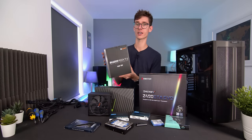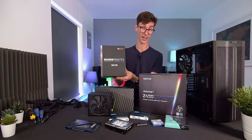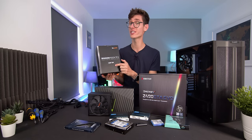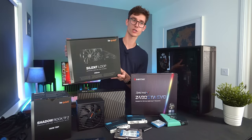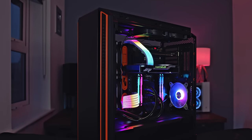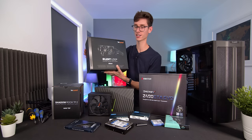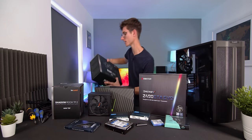Typically you're looking at something like this: the Shadowrock TF2, a Be Quiet air cooler rated for 160 watts TDP — a lot higher performance. Or you can grab yourself an all-in-one liquid cooler. This uses a radiator, water, and a pump head that sits on top of your CPU, creating a loop whereby the heat goes up to the radiator and fans blow that heat out of the case.